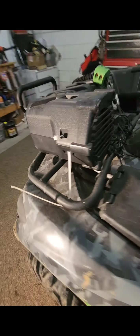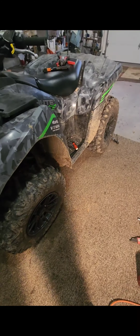Also underneath, something to remember to do, I'm going to go ahead and show you, but where your exhaust manifold is, right here on these bolts, put just a little bit of PB Blaster on them. Okay, so you don't want to mess those up. There's 2 on the front and then 2 on the rear. Underneath, you'll be able to see it. Just follow your exhaust manifold back. Spray just a little bit of PB Blaster on before you take those off, because you don't want to hurt those. So it's just something else that I was going to tell you to do.